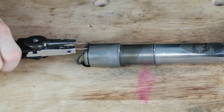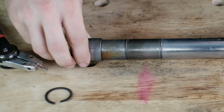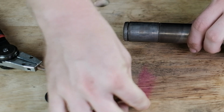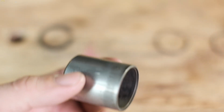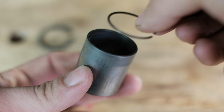They can be removed by taking off the lower snap ring and sliding off the piston, dampener, and spring clips in the order that they are on the fork tube. Keep these in exactly the same order that came off the tube, as well as taking note which is the top and bottom of each piece. They all have an orientation and have tiny recessed grooves that face a specific direction, like this one.